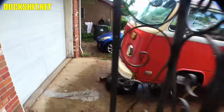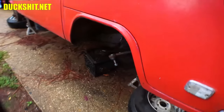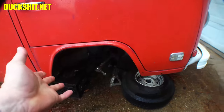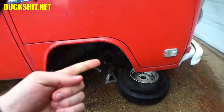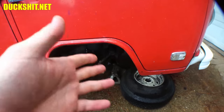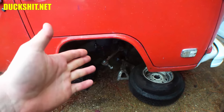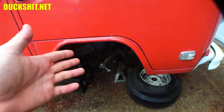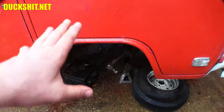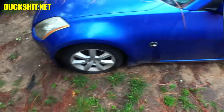I'm also missing a rubber bushing over on the other side. The rubber bushing goes on the arm on the bottom there. It's kind of crumbly, and it fell apart. Three of them were good, one of them was bad, which makes no sense because the other three look like they're brand new, so I don't know if somebody got under here and did some work before at some point. But nonetheless, it needs one more rubber bushing, but the problem is we can't seem to find an order for just one. So he's ordered up a set of four of them, and I guess I might as well just replace them all. So I haven't actually bolted any of that down yet. Everything's just kind of slipped together for the moment.